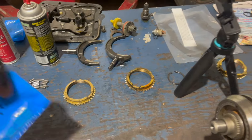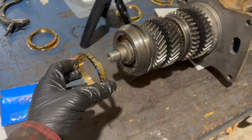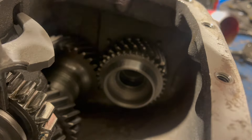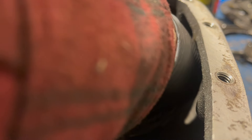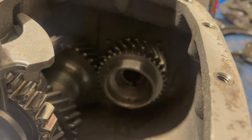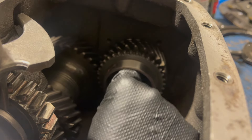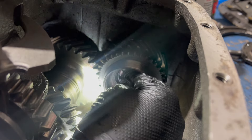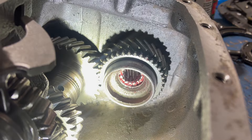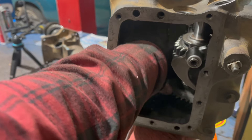Let's pack the roller bearing in the back of the input shaft. The process is exactly the same as the countershaft - the differences are there are only 16 rollers, also it's dark and you can't see what you're doing. As you're dropping the last one in there, you'll get a little bit of resistance as all of these things align. There we go - nice. Now it's time to install the tail housing and everything else into the case.